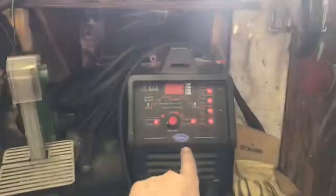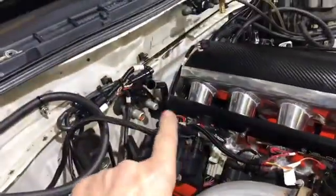And like you guys know, you know me, I'm not gonna fool around with it. I had enough of that. So I ground down the orb plug. I ground down the threads. I pushed it in, and I fired up the old TIG welder. And yeah, we TIG welded that in. So I let it sit with brake clean in it, and I didn't see anything leaking, but we won't know until I actually put fuel pressure to it. But we'll find out soon enough.